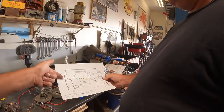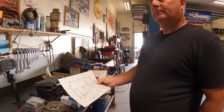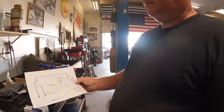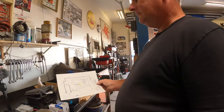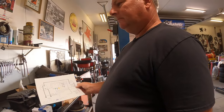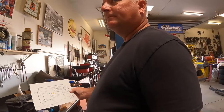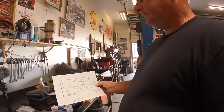So obviously the engine RPM is what regulates that voltage. On a diesel truck like a Cummins, they'll almost weld at idle. But on your Jeep with that little Chevy alternator, you'd probably have to hold it at about 1500 RPM to weld with it, and probably about 2000 RPM to get the 120 volts out of the small alternator.